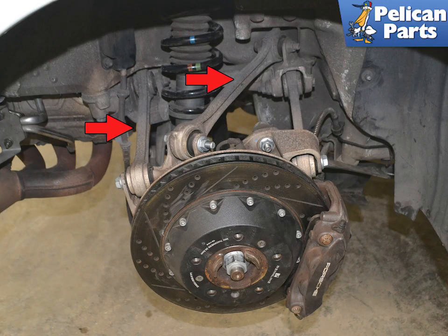If you are going to be working on the suspension on your 991 Gen 1, please note that all hardware is yield-to-torque or stretch bolts and needs to be replaced after every torquing. Let's start on the rear suspension.